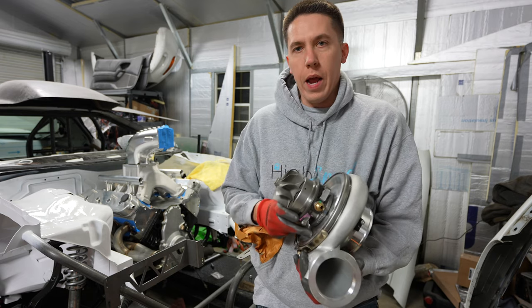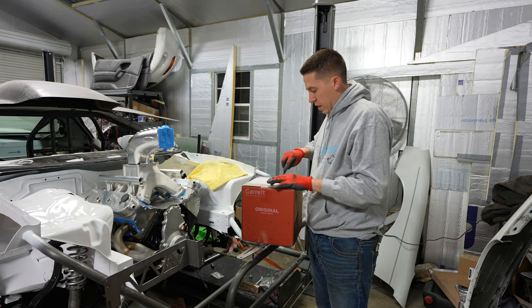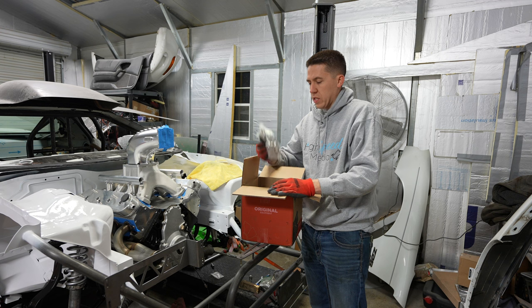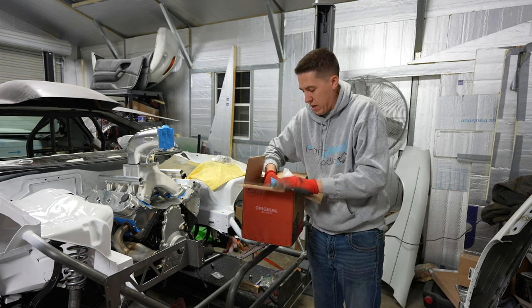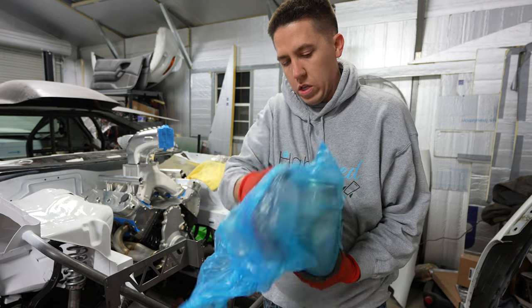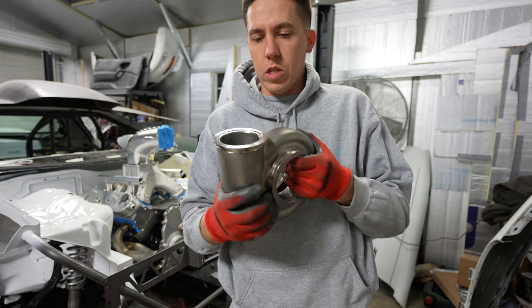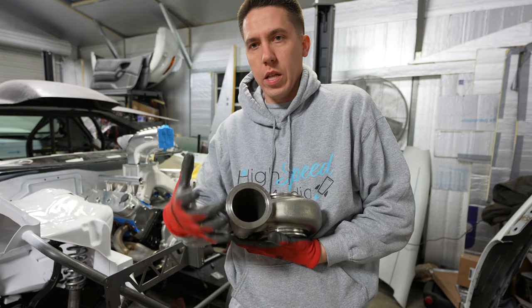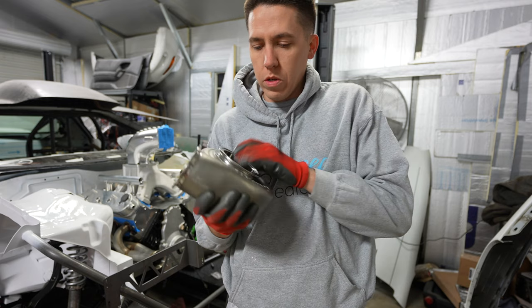Here's one of the exhaust housings — pretty heavy. This little box is just as heavy as that whole other box and it's just the exhaust side. We've got some V-bands, so that'll help with fabrication. There's a V-band on both sides — one that connects to the housing, and I opted for a V-band on the inlet side on the hot side as well. That'll make it easier for fabbing everything up; I don't have to mess with a T4 flange or adapting a round pipe to a square flange. It's all stainless and pretty thin, which saves room in the engine bay.